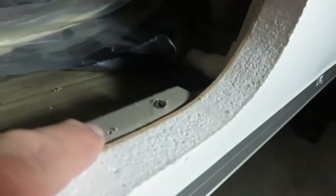This one's 3/4 of an inch, this one's a 1/2 inch, and those pilot holes, you can see one right there and one down here. Like I say, that way it doesn't split that out or anything. So now we're going to take and clean off everything real good, and I've got some clear silicone I'm going to put. You want to use 100% silicone, so the inside's going to have the clear, and then I'll tape off the outside, and I have some white to go around the outside edge.